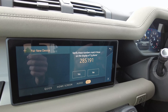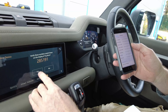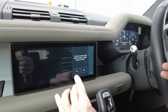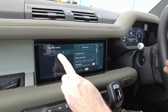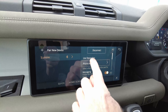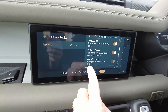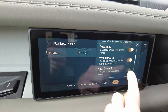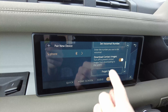It will probably give you a pairing code - verify the number displayed matches on both devices. Tap Pair on the phone first, allow contacts access, then confirm on the PIVI system. It will ask 'Enable CarPlay?' - select Yes. The system now shows options for this phone: you can see options to disconnect, use it for messaging, and set it as the default device. Make sure you also have 'Auto Connect' enabled for this device.